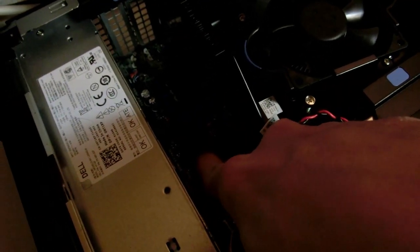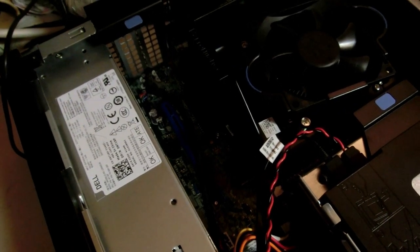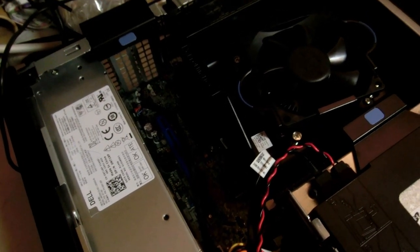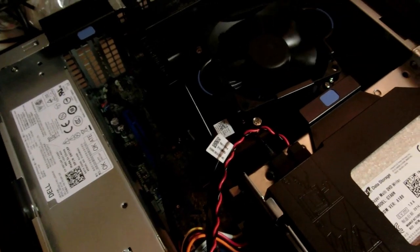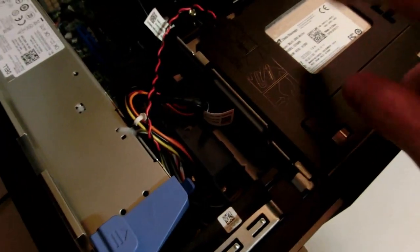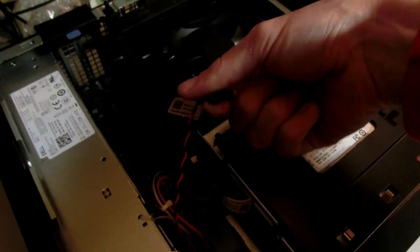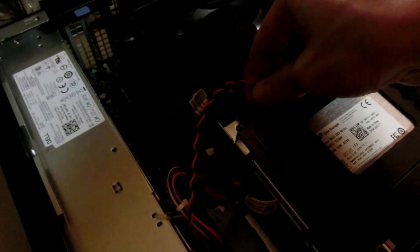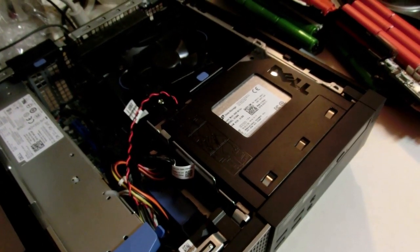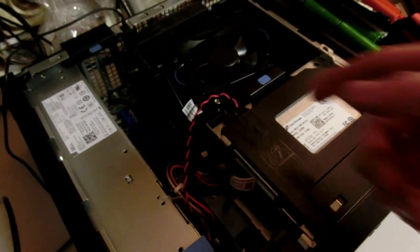We have a PCIe slot so I can hook up a nice short graphics card, which would be pretty good. Even with my Optiplex 320, I have an NVIDIA GTX 400-something with about 500 megabytes of RAM. I have a nice i7 processor, a 500-gigabyte hard drive, and a CD drive. Unfortunately, they don't have a full SATA power connector — they have a full SATA cable going to the CD drive, but not a full SATA power connector. So that means I can't readily hook up my SSD as a secondary drive, because I usually have no use for the CD drive and was planning to put the SSD in its place.